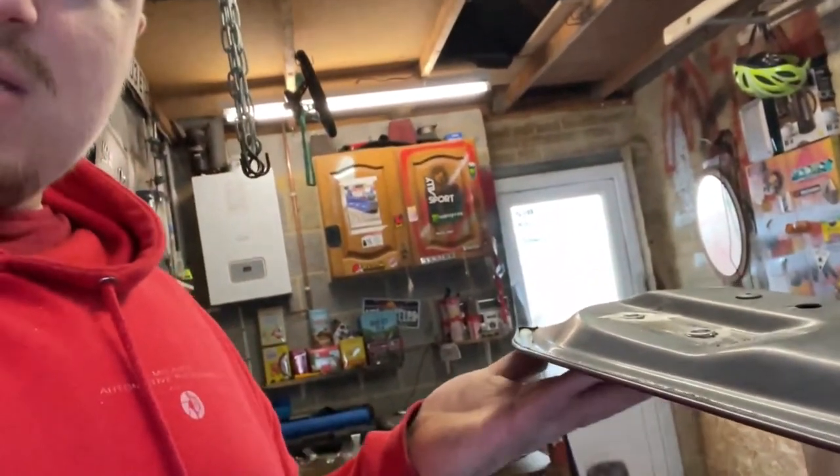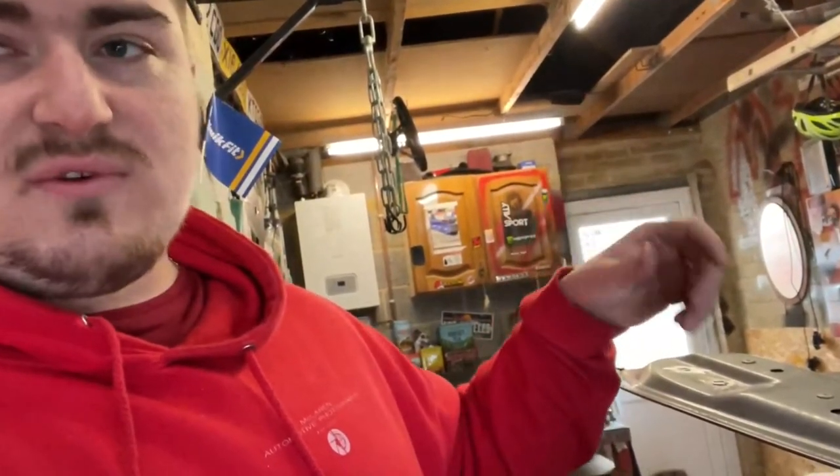I hope you've enjoyed this video — just a little DIY thing in case you break one of these studs. They're extremely brittle and really old; I can't imagine they'd ever been off this car — they still had original paint covering them, and even heat and WD-40 didn't get through them. A cheap rivnut gun does the job fine. Just drill them out, put a new rivnut in — it's deep enough that you won't hit the bonnet and you'll keep the paint nice. Effectively you're switching the thread to the bonnet: a bolt goes through instead of having a stud on the bonnet with a nut.